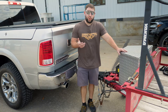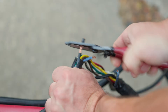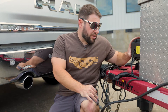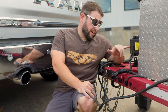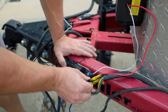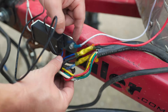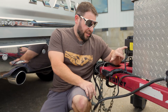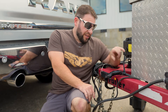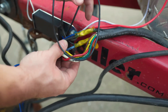With it all hooked up, it can be a little confusing. So we have a trailer here that needed a new breakaway switch and box installed, so we went ahead and did it to give you a better explanation of how it all works. It's going to need power — we're going to have the 12-volt come from the box, and then the power that comes from the brake switch. So it's going to be our red wire and our blue wire that connect to give them both power. Then we have the white wire that comes out of the box and it acts as a ground for the switch and the box. Then that leaves the black wire at the breakaway switch, which is going to connect to your brakes on the trailer.